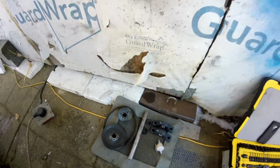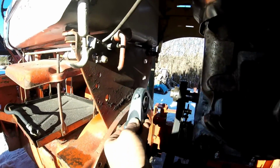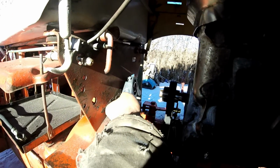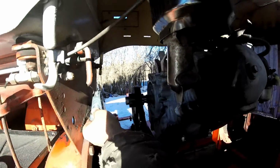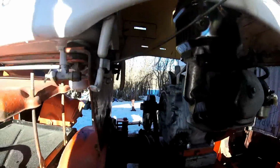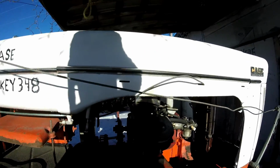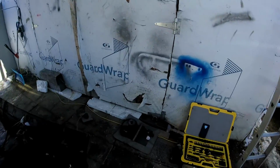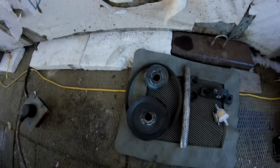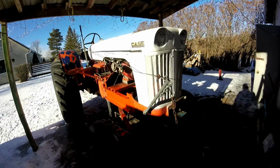So we're gonna take that, and we're gonna make a jack shaft. Gonna take a bearing and make a little plate on there, angle iron, and make the bearing sit about right there, right across, and there will be another one on this side where the motor used to be. So that'll drive that, and then on the other side of the jack shaft is a 3.5 inch with that 6-inch pulley on here. So that'll gear down another half. So that should be enough to gear down to what I needed.